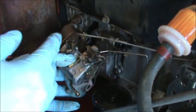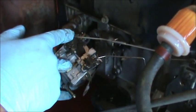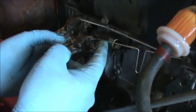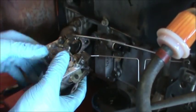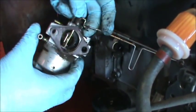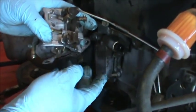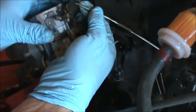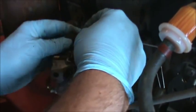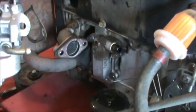We have two linkages: the bent one with the spring goes up to the front, and the one that has the U on it goes to the backside. We'll just pop these out and we should have access to our carburetor. Tilt it and work the spring out — there we go. So we've accessed the carburetor.